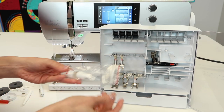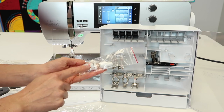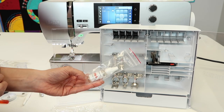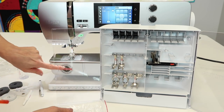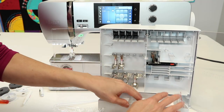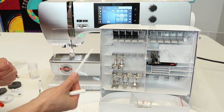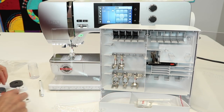Oil — we're going to talk about where you need to clean and oil this machine and how often. Hint: it's more often than you think. If you find yourself having any trouble with your machine working, it probably just needs a little drop of oil. We do it once a day — when you sit down to sew, put a little drop of oil in there. For linty fabrics, give it a good cleaning with the brush. No canned air — we'll talk about that when we do our cleaning video.